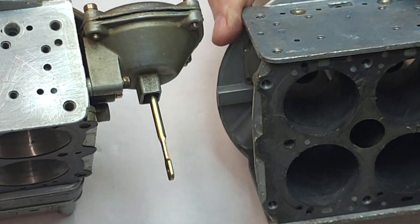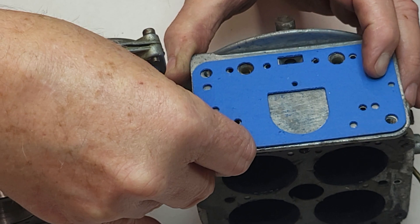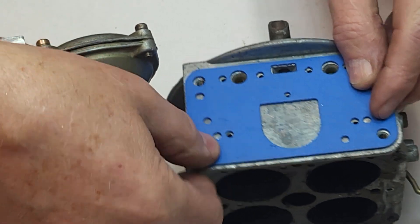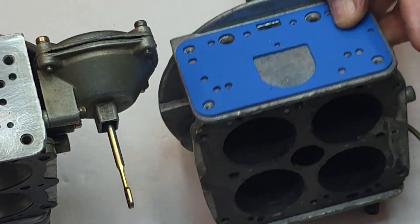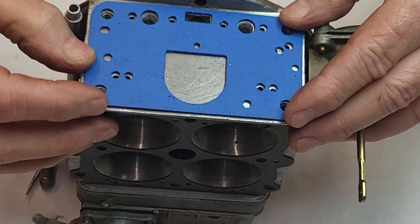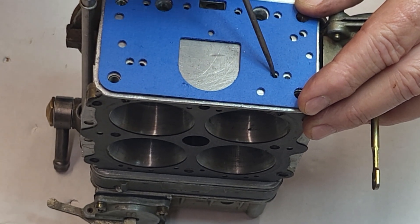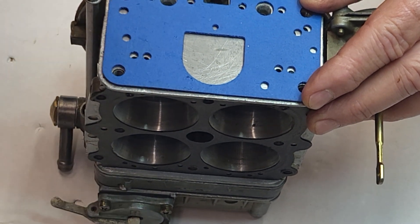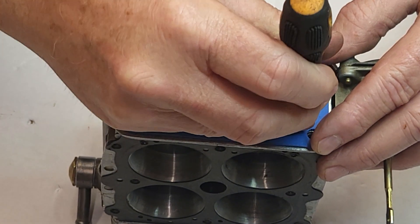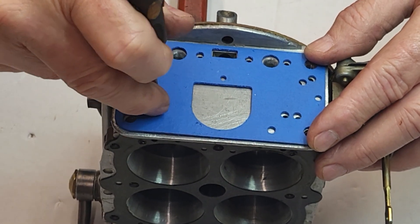Then I'll come over here and set a gasket right here. I don't know if I have it lined up perfect, but I'll try to do my best. Looking overhead here — there, that's pretty close. Then I'll center punch these two outside holes right here, right here and right over there. And that's what I've done right here — I just got through doing it. You can look at it here and see the holes. I hope I've got them centered pretty close. There are the two outside holes right here for the idle circuit. This is the transfer slot — it's already there, but the idle circuit has to be drilled from the bottom side and the top.